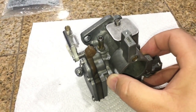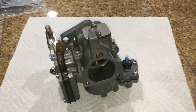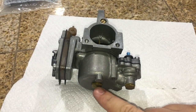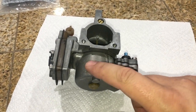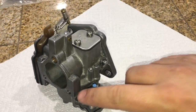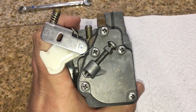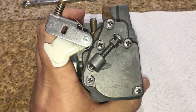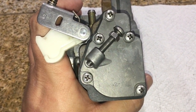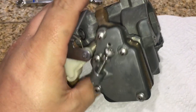I'm going to start here at the top and kind of work down. We'll loosen this screw here and then eventually the bowl will separate — the float is inside of here — and once that's separated you can take these four screws out of that side. One thing to note: you may have to loosen that jam nut, which is an 8 millimeter, and back that screw out to get to the bottom left-hand screw, then set this down.